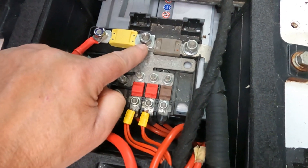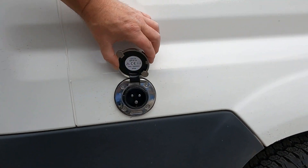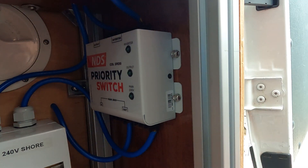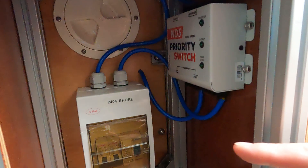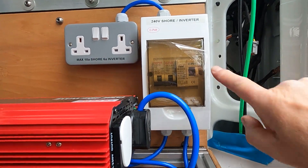With a 100-amp mega fuse in there for protection — I've bolted the mega fuse directly to the battery terminal and cushioned it on a bit of sponge. My shore power comes in at the side of the van in a marine socket in stainless steel rather than the usual plastic. The power comes in through the side of the van with an access port I've put in there in case I need to maintain that socket. The shore power comes straight into the van to this priority switch, which allows me to switch between shore power and inverter power automatically. This means I can use all my 240-volt sockets inside the van without needing a separate system for both, and the priority switch will automatically prioritise shore power over inverter power, saving battery life. It also has a spare port at the bottom from shore power only going to an RCD box which feeds the boiler, while the other port goes to an RCD box supplying all the sockets in my van.